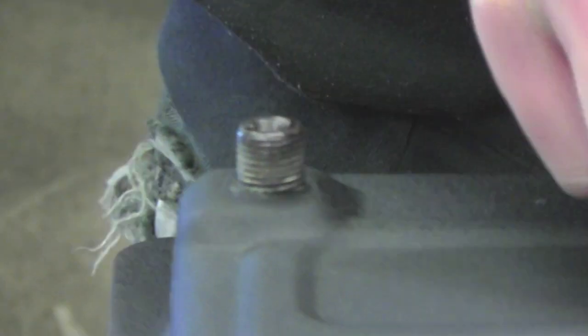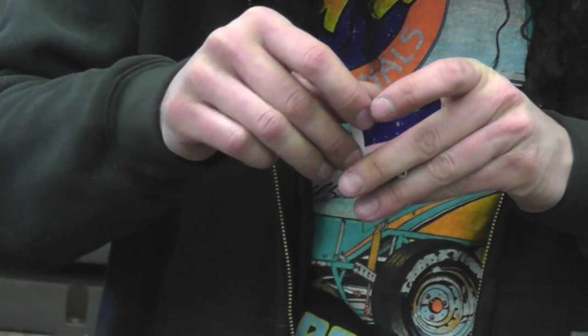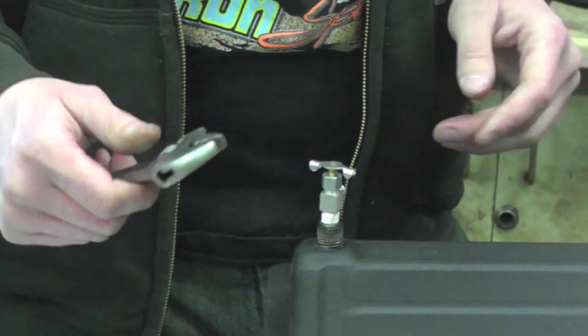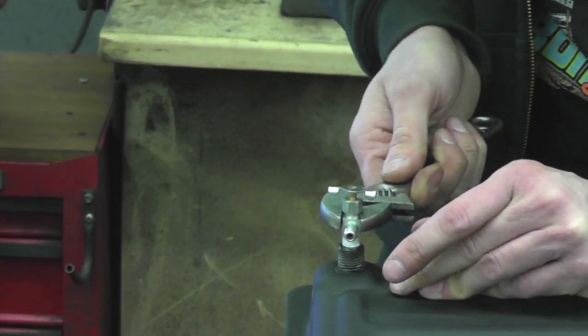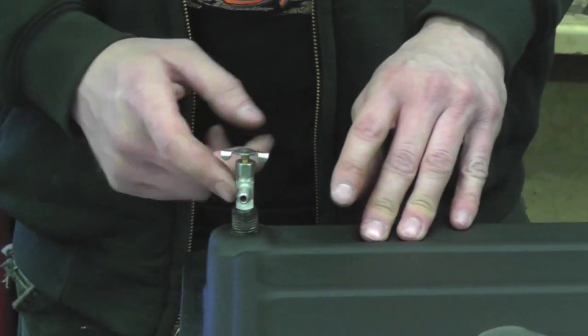It looks like it's in there a little bit — it's about halfway. Now, you're going to want to take some Teflon tape — you can get this at any hardware store. Just rip a little piece off and tear it with your hands unless you're a weakling. Stick this on here and wrap that around. That's going to help seal it. Screw that in. Now, you're going to want to get into position where the fuel line is coming out, going into the carburetor. You don't want to hammer it down in there too tight — that's about where you want it. And there you go. That's to open and close it now.